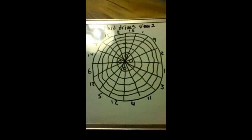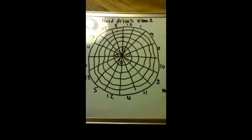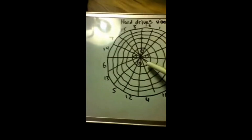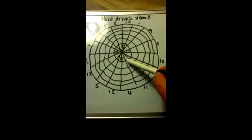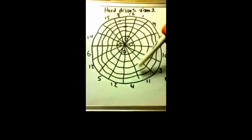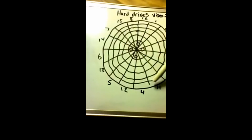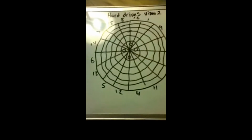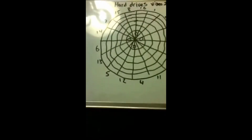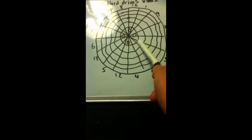Usually, when data is crammed in so far, in such space, it gets corrupted. So each sector that's got a corruption has a band over here to swap it out with. So some programs are designed, okay, if the sector's over here, it's bad, write what you can, gather all the data, talk to the hard drive, get the new sector and swap it, and put the bad sector here. By that time, all these sectors here in this cylinder are bad. What happens then is all the error correction fixes all the cylinders in this cylinder here, this ring.